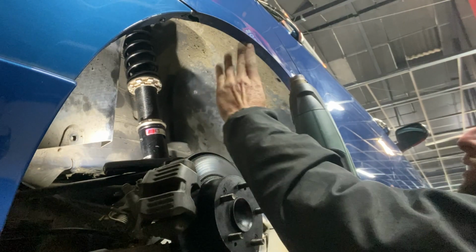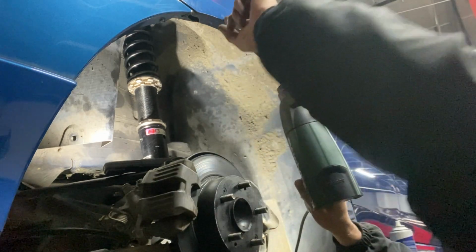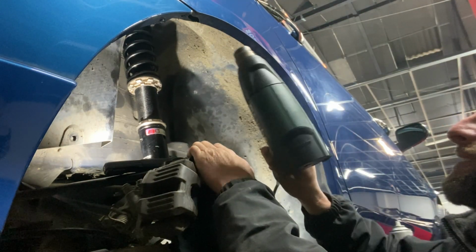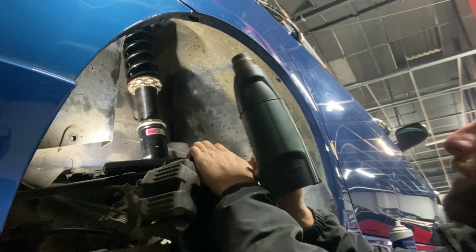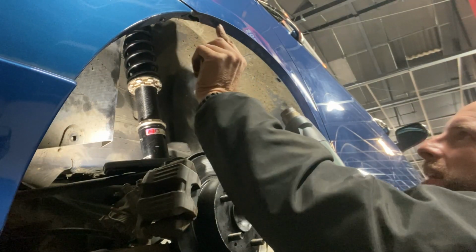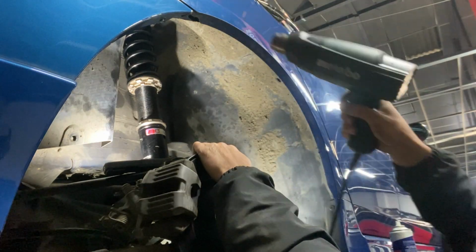Whatever you do, don't cut slots like that. It ends up making big fold marks in the outside of the guard. If anyone's tried that, you can attest to my understanding of it. I definitely learnt the hard way in my younger years. So now I just keep it simple, I keep the lip all together. Potentially you could trim it back smaller, but I don't seem to bother. It will stretch up nicely.